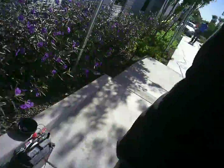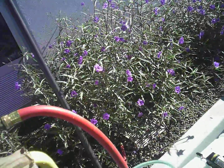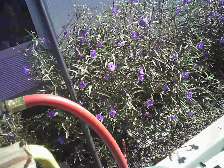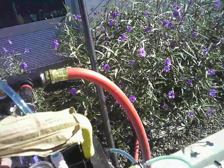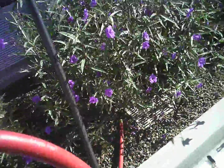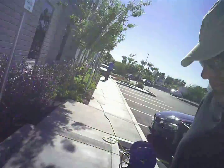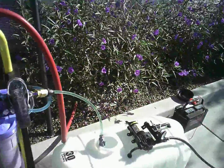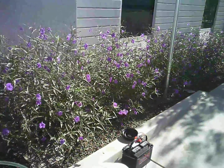DI is a chemical way to clean the water. What we're doing is taking the RO from three down to zero — that's where you eliminate spots. You could do RO at 10 and maybe DI at five, but it's not that expensive to keep it at zero. The whole kit — charcoal, sediment, and DI — is about $75. Twice a year maintenance, maybe $150. That's it. The pump turns off automatically, so it's all self-contained — just provide a car battery.